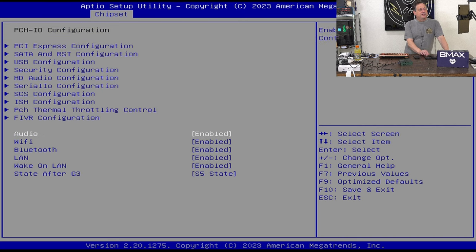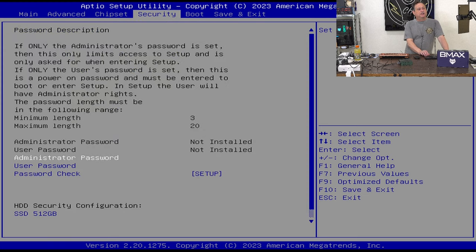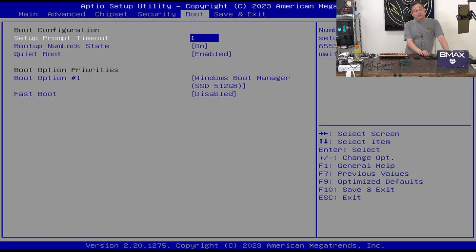Well, we have the ability to disable the Wi-Fi and Bluetooth. If you wanted to put an upgraded Wi-Fi or Bluetooth adapter via USB, and you didn't want to confuse yourself by having two Wi-Fi adapters and two Bluetooth adapters, you could come into the BIOS and disable the one that's soldered down at the very least. So that's good. Better if it wasn't soldered down.